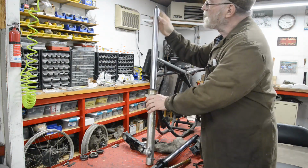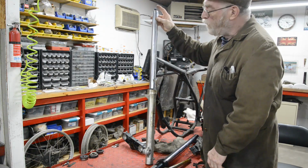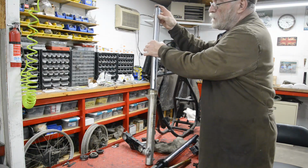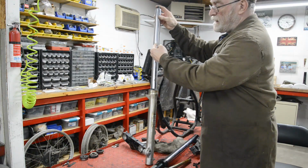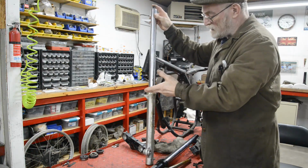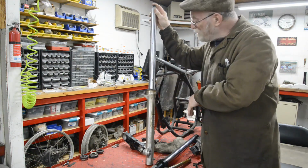But instead of having a valve on each fork leg, they only have one valve. It's on one fork, and then here you'll see there's a hole. There's this collar that goes around there and around the other fork with a piece of tube that joins the two together. When you pump the one up, the air goes into the other one. So that's all adding complications to it. So I'm really hoping we can use the KDX ones, because that will be much better.